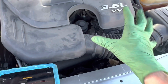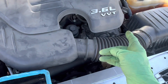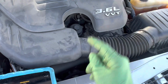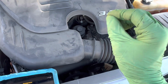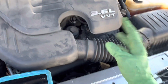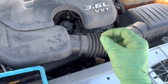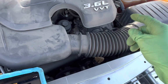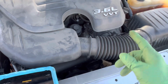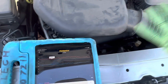And on this specific engine, the Charger, whether it's one of the larger engines or smaller, oh no, it had 2 different compressors. That was the difference. They're both 710 grams, but the only difference is one uses the Denso oil, and the other one is the Ford equivalent to a Denso, which is the FD 46. Wow, I forgot. It's such a common oil. I use it all the time and I forgot the number. But you got what I mean.